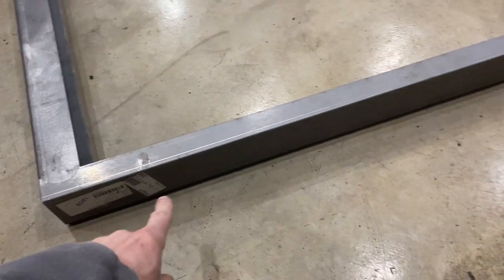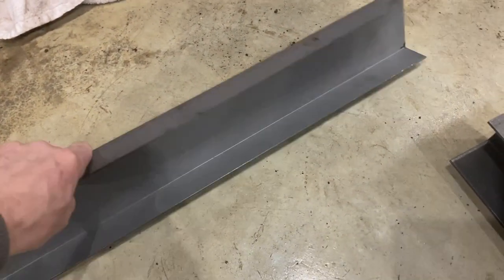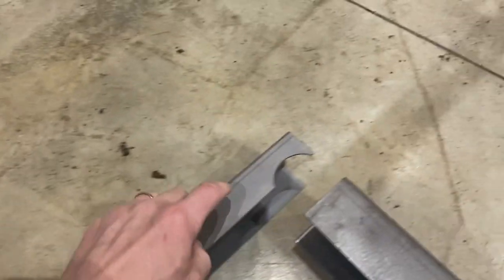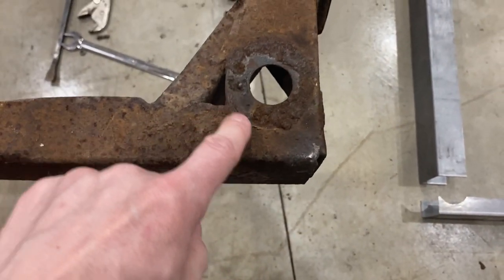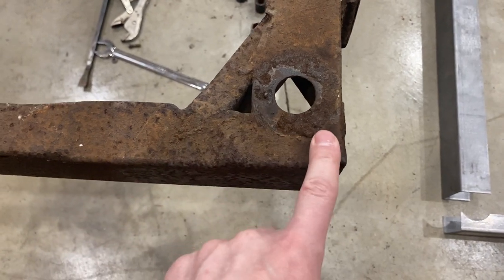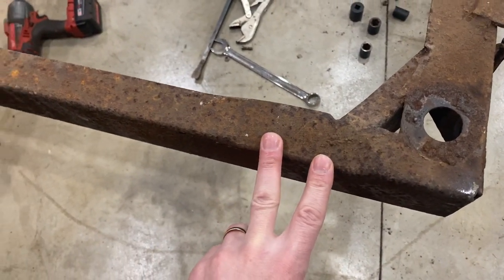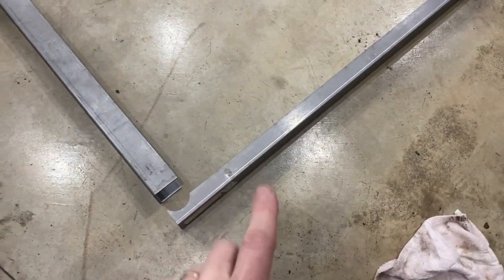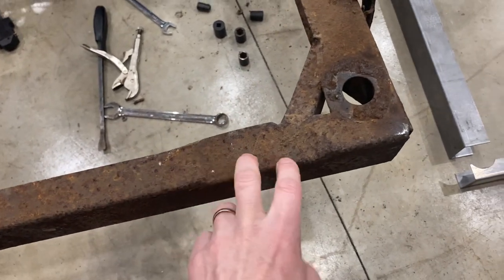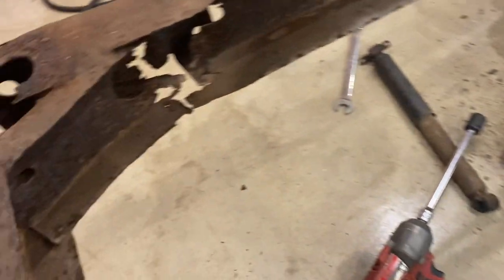This rear piece right here I actually bought, because that is a part you can buy. It's actually a little bit thinner metal — it's not eighth inch. It has the little cutouts for the body mounts. So you can see this one is actually cut out just like the replacement, but the factory rear metal is angled right here on both sides, and the new one is not. So I'm going to have to do that when I install it because I assume there's a purpose there. I also have to rebuild these things and make my own — I'm not going to reuse the old ones because they're rotted out and trash, especially on this side.